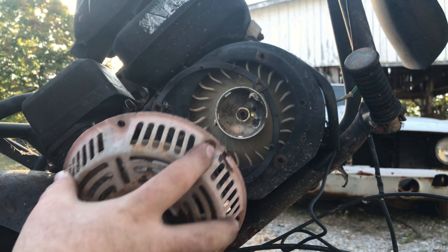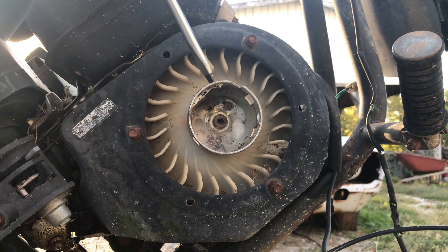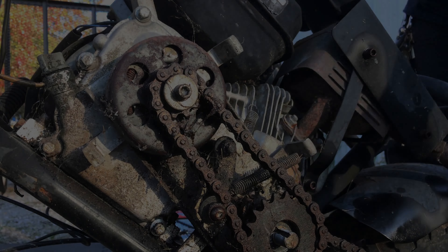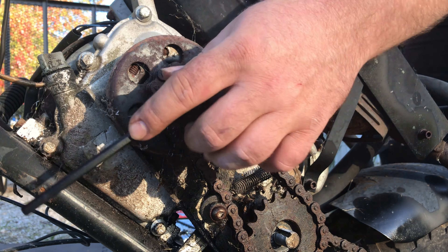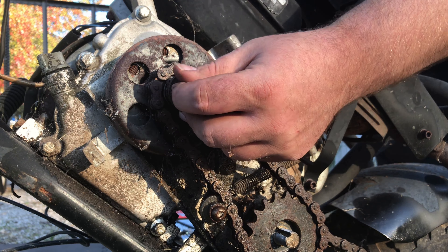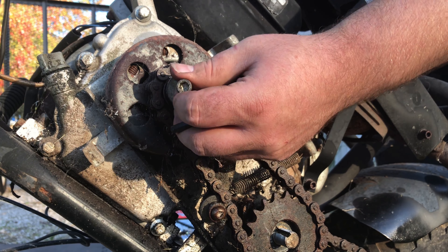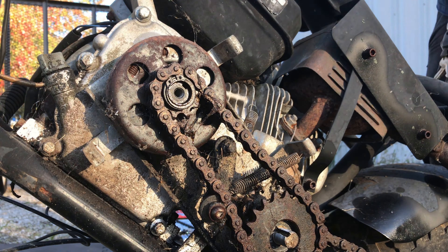The paint's falling off — faded out. This one's got a spacer. These have like the little 196cc engines on them. He's using a 6 millimeter Allen wrench on that clutch bolt. I think most of the Allen wrenches you need are like 5 millimeter and 6 millimeter, so even if you don't have a whole metric set laying around you should be okay. He dropped something but he picked it back up — good save, son.